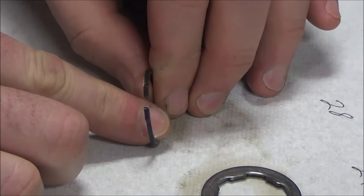Oh, holy smokes — here's a bad one. Think that got overused? Here's the problem for some technicians: it's so consistent it looks like it was possibly supposed to be that way. What I want you to notice is the relationship to where the raw casting was — do you see here how it started to dig in this direction and is getting thinner? That's a real obvious clue that this is terrible and in serious need. Also this whole recessed edge literally got dragged and spun around there.